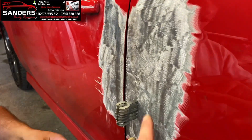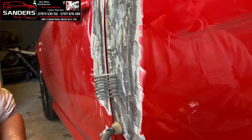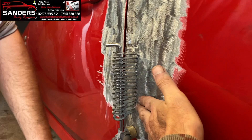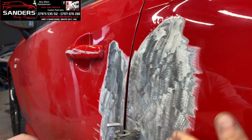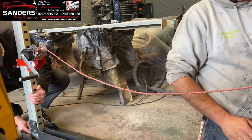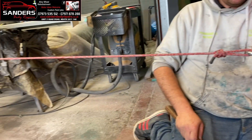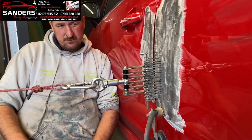So that initial pull down this line was more structural. We're going to start pulling the dent out - you can see already the vast improvement. It's almost there already. So we're on to pull two now, actually taking the dent out itself and following it. Matthew's tapping it in because remember metal shrinks and stretches - you've got to work both areas at the same time. Sucking this onto the ground making sure it doesn't lift, and the great thing about this tool is it didn't bounce back or retract.